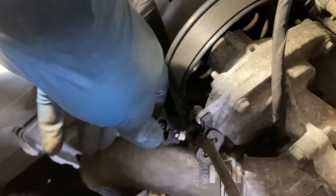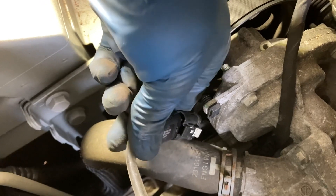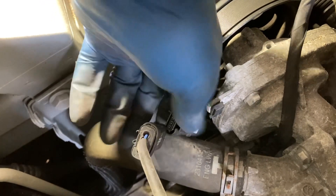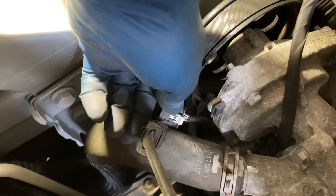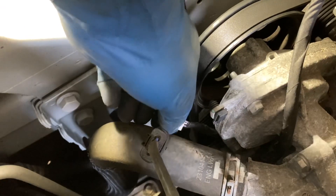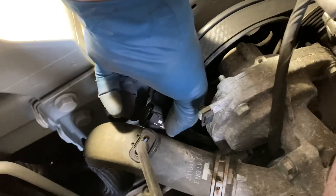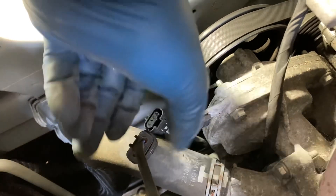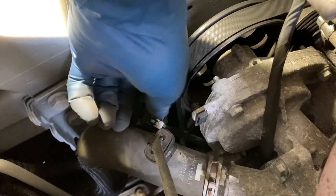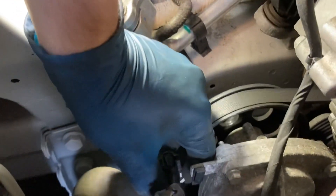Unplugging the oxygen sensor is kind of tricky. The bottom part is the oxygen sensor side and it plugs in like this. The way to do it is to flip the white tab down, push it down along its slide direction — push it down twice all the way. Then squeeze the white tab in, compress the bottom part in, while pulling the top part out. So push the white tab down twice and then squeeze it kind of towards the wires in.